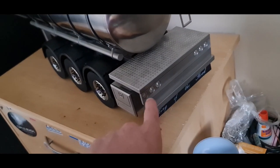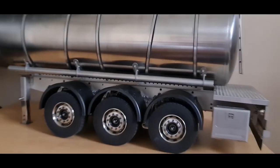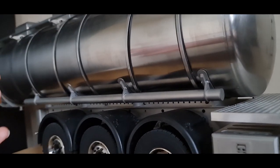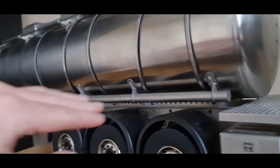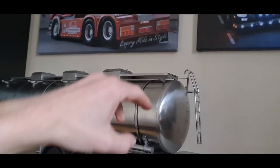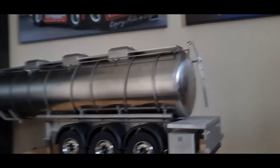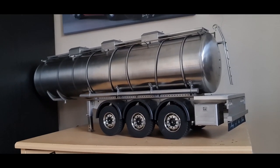For lights, Miro will make me a set of rear lights. I'm going to have to make little arms to hold the bulbs in place — bent to the contour of the tank and stuck on there. On my tipper I made little aluminium arms with a 90-degree flange at the end to mount a marker light. I want a row of marker lights along the bottom and ideally along the top, two red lights up top, and maybe two white lights at the front in the same style. I've got plenty of time to plan as nothing's happening until spring.